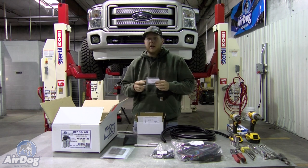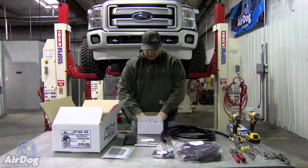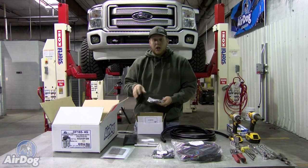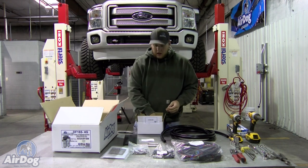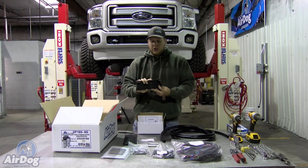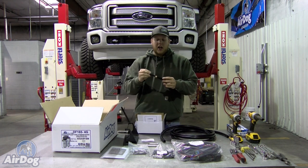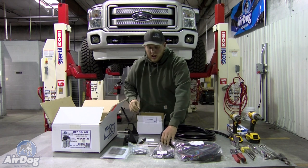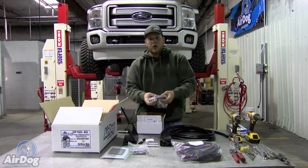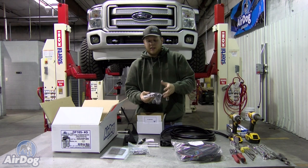This is your customer service o-ring kit — it comes with every o-ring needed to service the AirDog lift pump if you ever need. Keep a hold of that; throw it in the glove box. This is your standard hardware bag — it comes with the bolts to mount your sandwich plates to the frame rail as well as your pump to your sandwich plates. This is the spacer block that will be used when mounting the AirDog; it will go in between the cradle bracket and your sandwich plate. This cradle bracket has that same finish as the sandwich plates. It also comes with zip ties so you can clean up your wiring harness as well as your lines after install. Here's your assorted fitting bag — you'll have your aluminum fittings that thread into your base, and plastic push-lock fittings to allow for connections on the factory fuel lines. These are J2044 style quick connects, exactly the same as OE uses — this is what allows our kit to be very non-invasive connecting to a lot of factory lines.